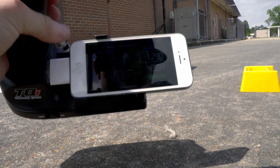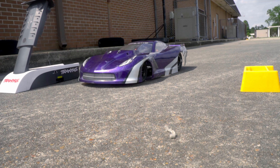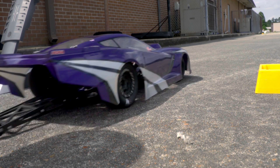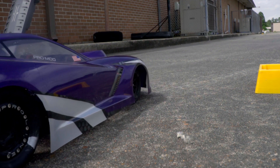The car is pretty consistent in the mid to upper 1.70s and anywhere from 40 to 45 miles an hour. I think I'm spinning a little more than I want off the line with this new battery in — though while editing I could clearly hear it's the slipper clutch slipping, not the tires spinning. It's actually hooking pretty well, so I just wanted to clear that up. This battery normally only lasts me about 15 to 20 passes anyway, so let's knock them out quick. I'm kind of happy I had that pass at 120 frames per second — that should be fun to look at in slow-mo.